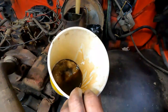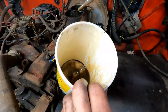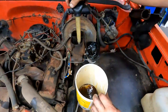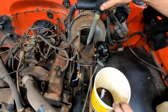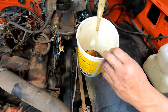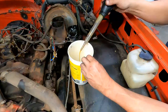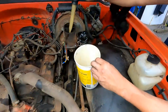Yeah, it doesn't look like just brake fluid anymore. Somebody screwed that up. So when that happens, every piece in the brake system that has rubber in it is gonna have to be replaced. So it's a proportioning valve, the brake lines, not the hose? Oh, rubber hoses, yeah.